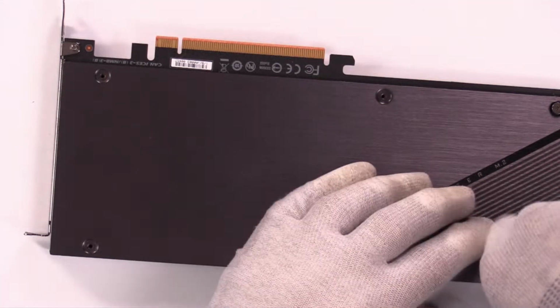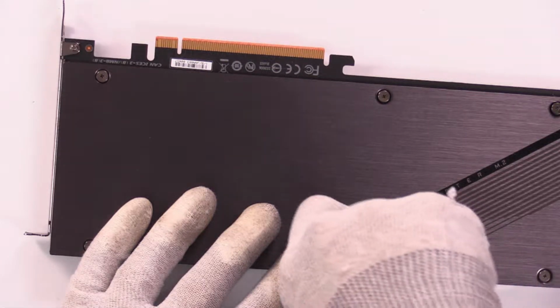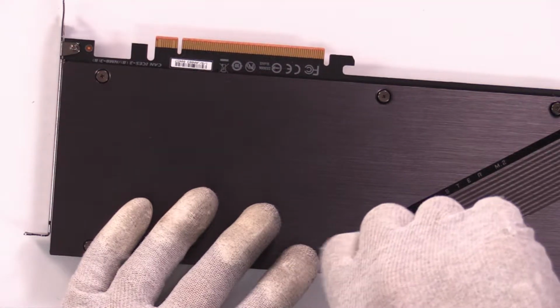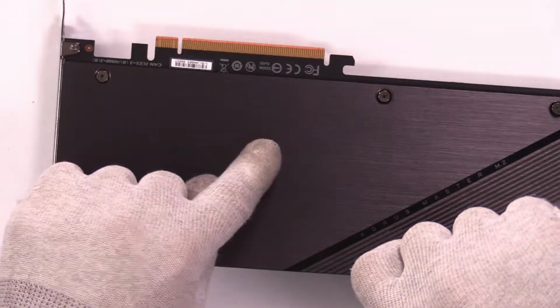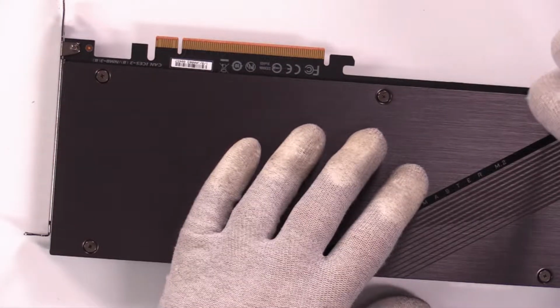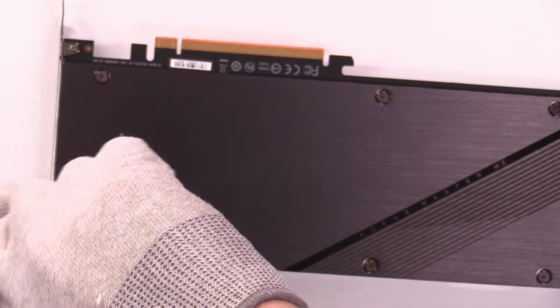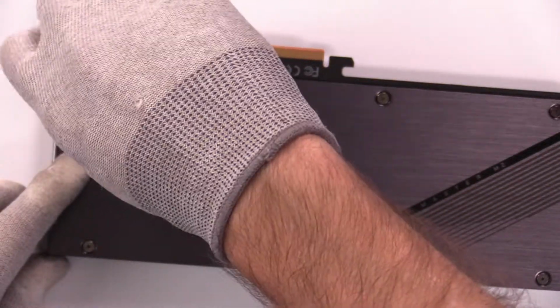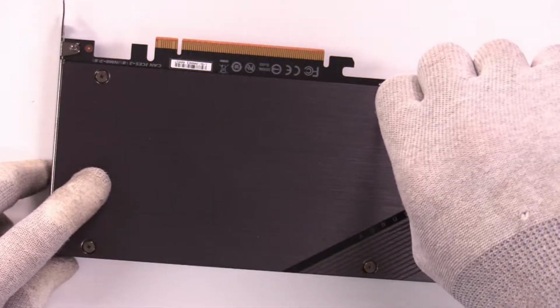Not an issue on the Gigabyte Aorus. Because the slot is already bifurcated in the BIOS, all I will do is go to the BIOS and verify that we see 4 drives from the boot menu, which will be 4 drives on this card, 5 drives total because of the one that's on the motherboard. Then we can go into Windows and give those drives time to enumerate. And if I'm not moving too quickly, they should pop up once the operating system recognizes them. Then we can do our tests.